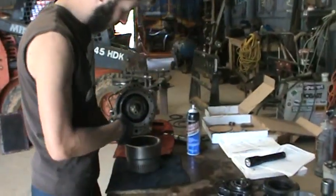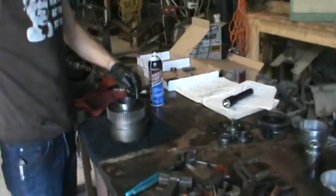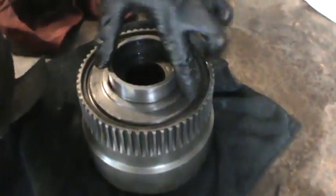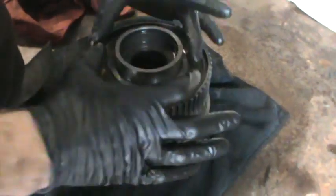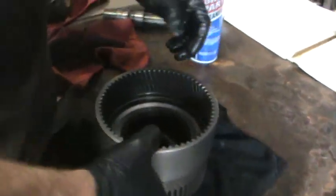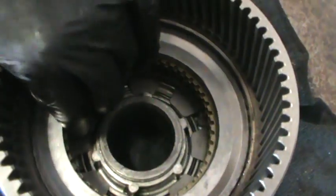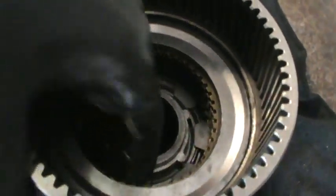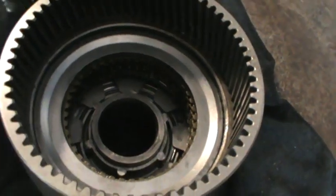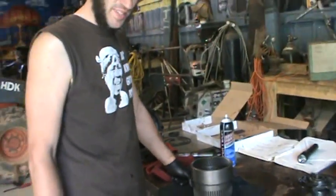Those are out. The new ones are already in. This thing has snap rings — there's a snap ring around this little lip, and you pull that snap ring free, and then this whole chamber comes out. You can put your new clutches in, put your new seals in. Those right there are your forward clutches — makes you go forward. So when you think your automatic transmission is really tough, that's all you got pushing you: a bunch of small clutches. Scary, huh?